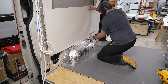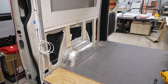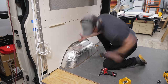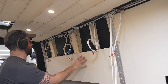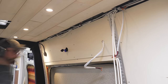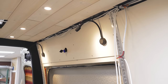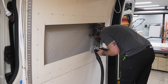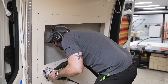Next I got the panel below installed, working around the wheel well — thankfully we had a template for the wheel well from Titan Vans. I then moved on to the last big wall section around the flare on the driver side, which had some electrical elements to contend with, including two gooseneck lights and a USB charger. Before tackling the final trim ring, I decided to go ahead and flush-trim the plywood in the two openings I had already installed, and I ran into a little trouble.